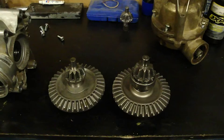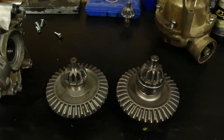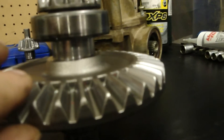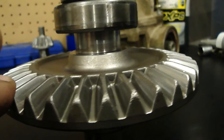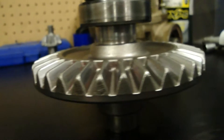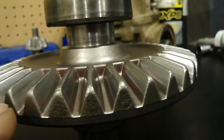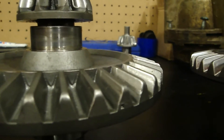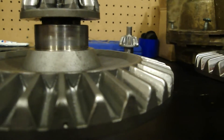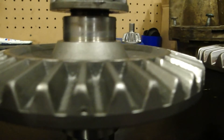Moving on to the gear set. Now I'm not a metallurgist, but one thing that appears to me is that the 2015 ring gear appears that it isn't as hard or isn't as hardened as the 2012-2014 ring gear. There is a wear pattern forming on those teeth and that's not typical for the 2012-2014 gear set. Those ring gears, if you caught the failure early enough, would rarely even have a mark on them — they still look brand new.